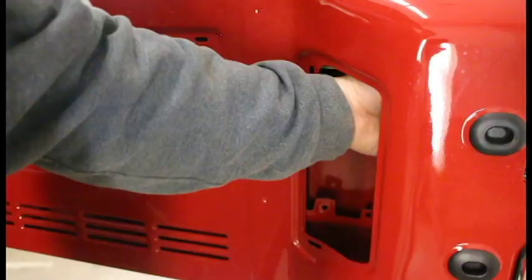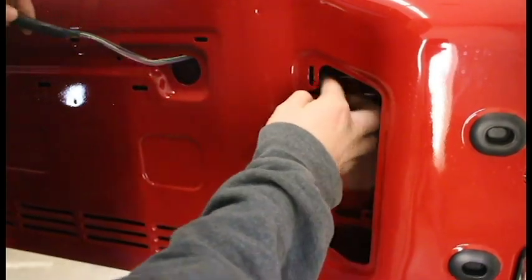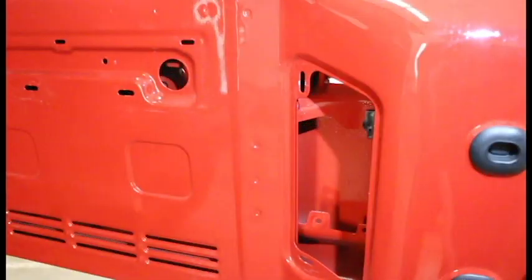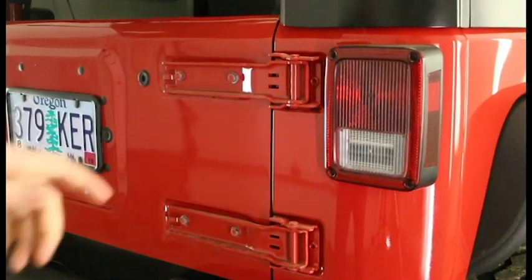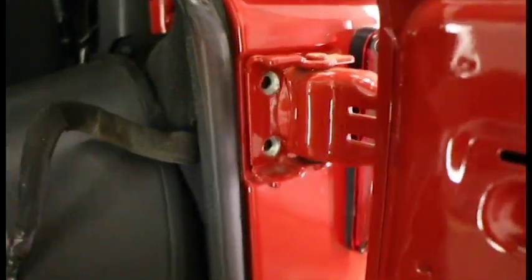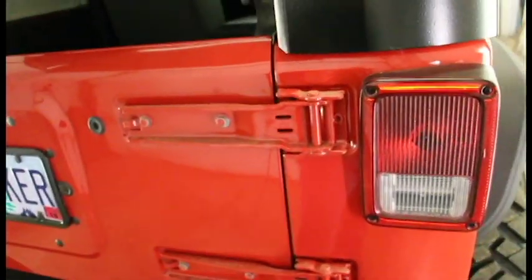Okay, so we got the clips off. We got that off, and then you just feed it through this hole here. So now our door is completely stripped. We will work on taking it off. So right here in the back there's three T45 bolts. So I got these four bolts off. Now I'm gonna take my tool. Shut the door. And then do these ones on the back side, and then take the door off.